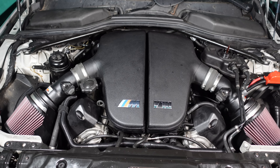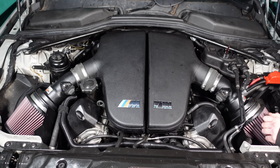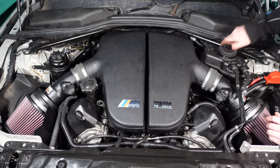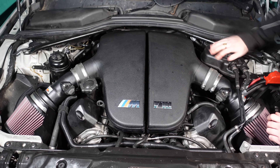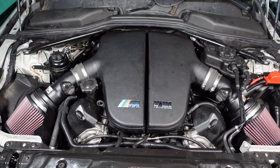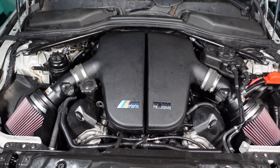This is going to get all the air out of the system before we start the car, so we don't end up with air bubbles or trapped air — that way the car can come to temperature correctly. I believe that's done it for now; any remaining air will bleed itself to the top as it has a self-bleeding system. We've got the majority of it out. Now we're going to go ahead and start it up. First, I'm just going to cycle the ignition once for the injectors so fuel gets to all of them.